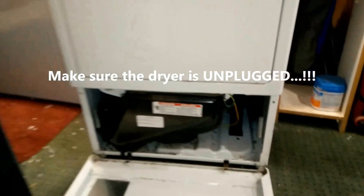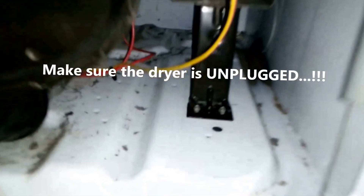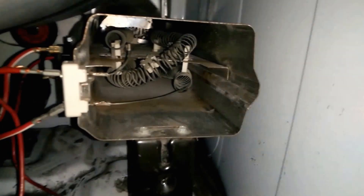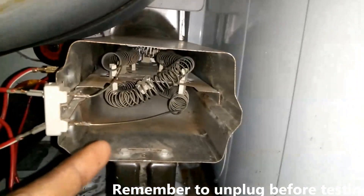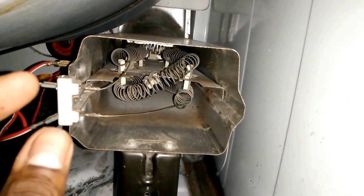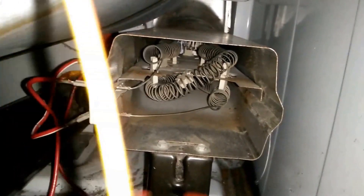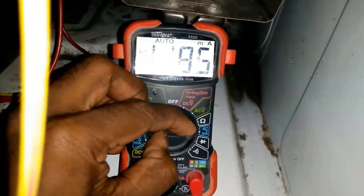In order to do anything with the heating or the belt routing, it's ideal to take the bottom panel down so you can get a better idea of what's inside the dryer. Here's the dryer and what you're directly staring at is the heating coil. This particular heating coil gets really hot when supplied with 240 volts between these two terminals. Sometimes these coils break and that's a reason for the not heating. The way to quickly tell if the coil is good or not is to check its continuity to see if there's a break in the middle.